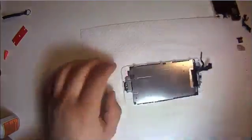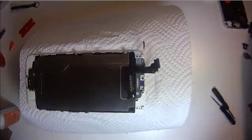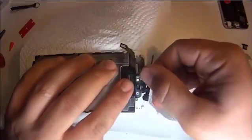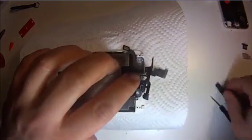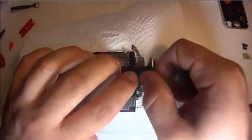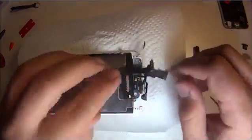The glass that we have here too, sometimes you buy the iPhone glass from China, and then what happens is that your phone works and then your sensor doesn't. So you have that sensor that whenever you're on a phone call, you always mute people, and it's because the sensor is supposed to power off when it's on your face. So obviously if you have cheap glass, it's not really gonna power off. It's just gonna be lit up the whole time that you're talking on the phone.